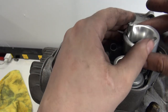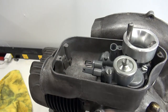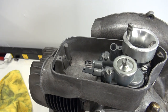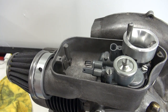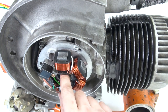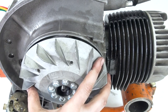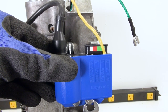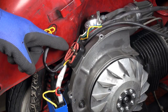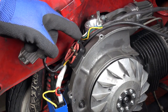As for the intake, we are not using an air filter but we're using a Polini venturi, which is tightened down with one bolt that you really want to lock tight because you don't want that thing to fall in. With the air filter holder from Polini I used a mesh filter, which really looked well with the engine and the overall look of the bike. As it comes to the ignition, I already have a video up — this is the Scooter Mercado sponsored video on a BGM ignition. I put the link in the description, you can check it out. It has full instructions on how to install this kit and this is the engine that we did it with. Once it was wired up and inside the frame, it was time to fire it up.